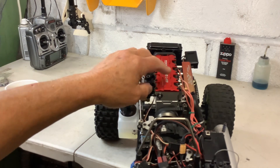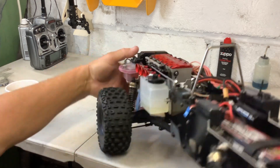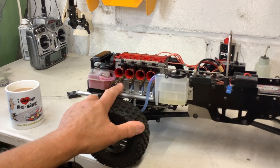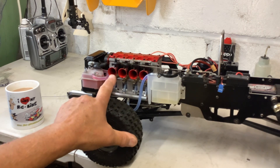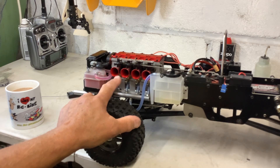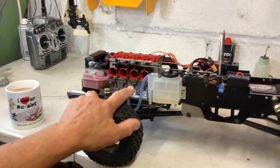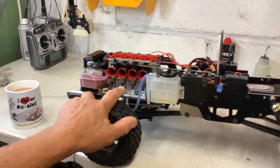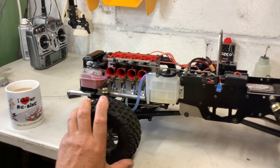It's got a little misfire on one cylinder which I can't quite work out. With these four carburettors on here, when you get it kind of near enough you don't want to mess it up again by giving it a tweak. I've been on Toyland's website and it looks like they're making an inlet manifold for one carburettor, which will be absolutely fantastic. This four-carb setup looks good but it's really hard to tune - there's no way of listening to what it's sucking like in the old days. I've gone with the needles out exactly the same, and when it's cold it's a little bit rich, but when it warms up it starts to sing and sounds absolutely wonderful.